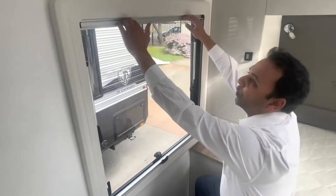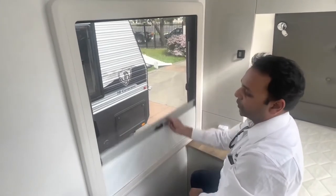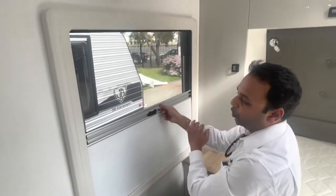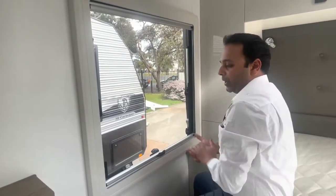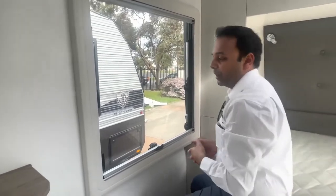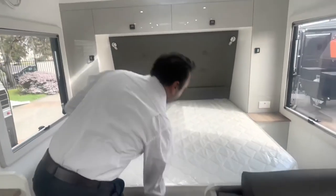To use the blinds, always use the top one with two hands, applying pressure on either side. Pull it down — it locks in by itself and you can adjust how far you want it to go. If you want to open the blinds back to normal position, click and it goes back up. The traveling position is fully up. Make sure you don't leave the blinds blocked out for a long period on corrugated roads, as it will weaken the springs — you want them in the up position as much as possible.